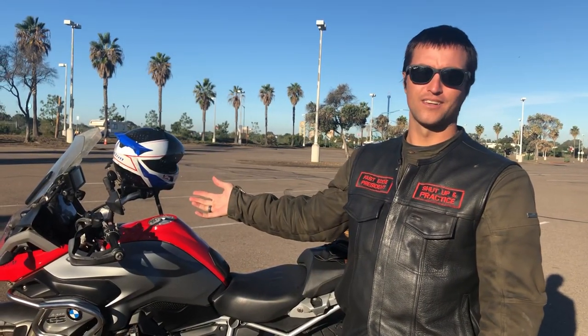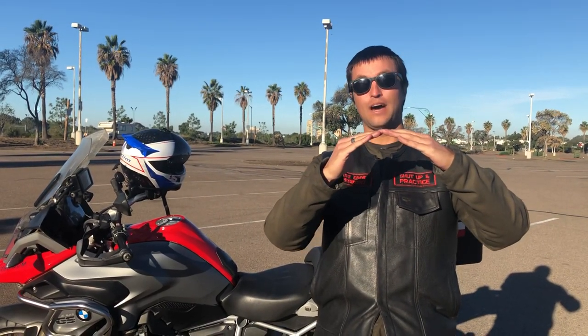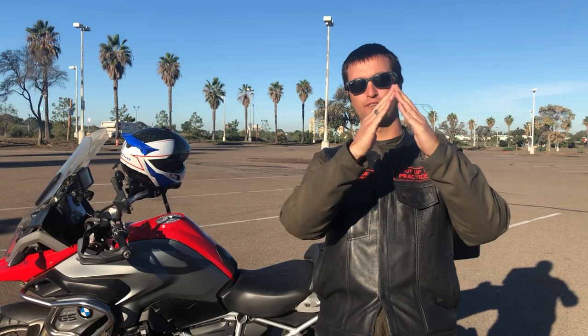They jacked up my bike, because I didn't realize maybe I had round shaped tires, and now I put on a tire that's more of a profile like this, like a V shape. I didn't know there was two main profiles of tires. So when you buy new tires, you might think the steering is now jacked up, or they did something wrong with your bike. You may have just went from a V to a round or vice versa without you knowing it.